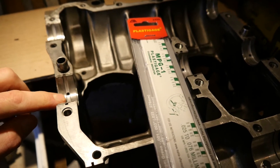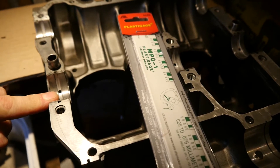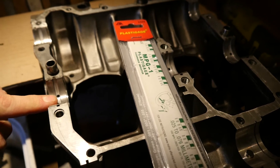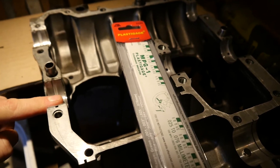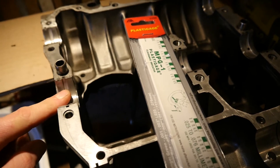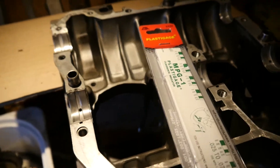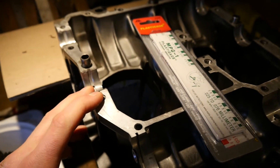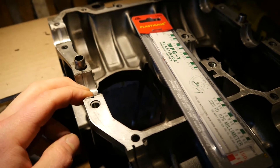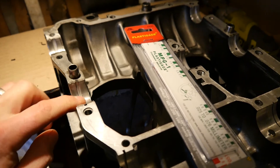You'd need to measure with a micrometer or vernier calipers — the diameter between that and the upper shell bearing, and then the diameter of your journal, and subtract the two, and that would give you an oil clearance. However, there's a large amount of error that could be in those measurements if you're not very good at it, or you don't do it very precisely, or your calipers aren't properly calibrated.